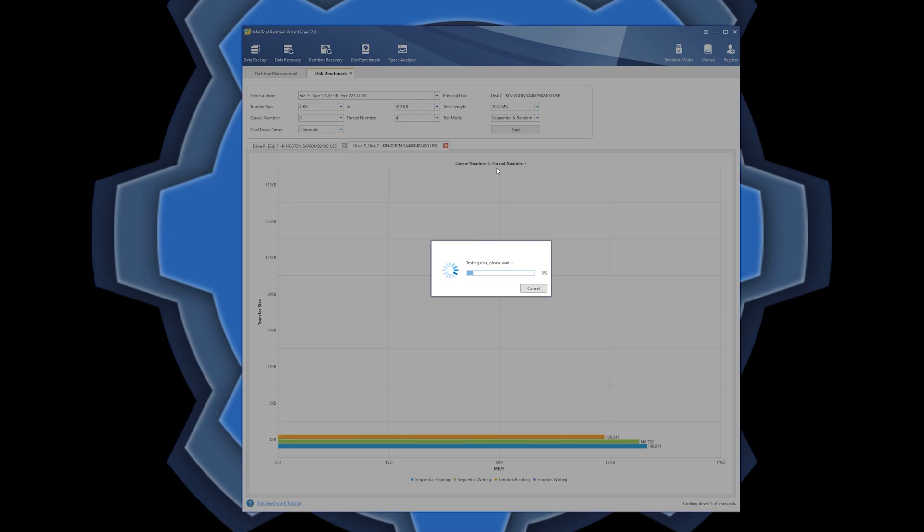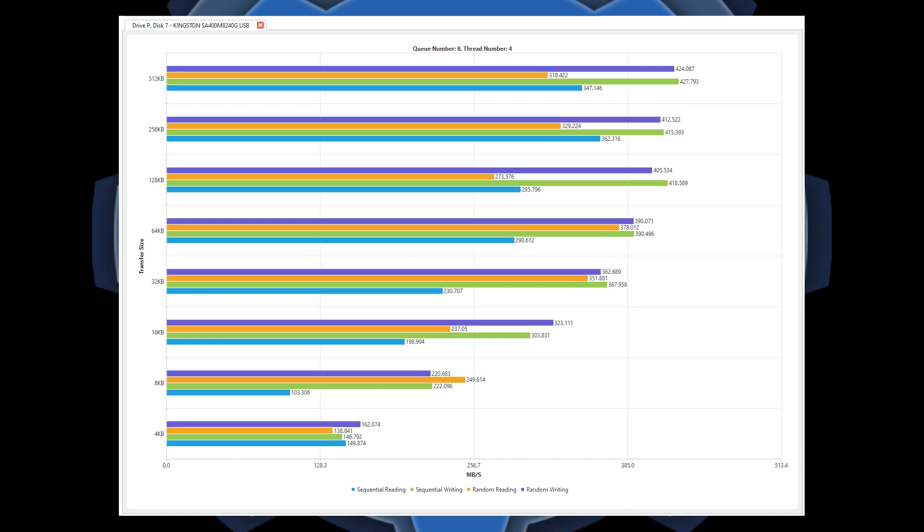It's time to talk about performance. There are a couple of things to consider. First, the speed of the drive is going to be crucial — if you get a poor drive, the speed will reflect that. I got an average drive with speeds up to 500 MB per second, which is fast enough in terms of SSD and plenty for the Raspberry Pi. It's so fast that it won't matter that much for local operations, and as soon as you use this as network storage you'll be limited by the bandwidth of the 1 Gb connection anyway. I ran a speed benchmark of the drive attached to the board via my computer to confirm the board itself isn't hindering the drive's performance, and the results are pretty good — not quite the full 500 MB per second, but close enough to validate the result.